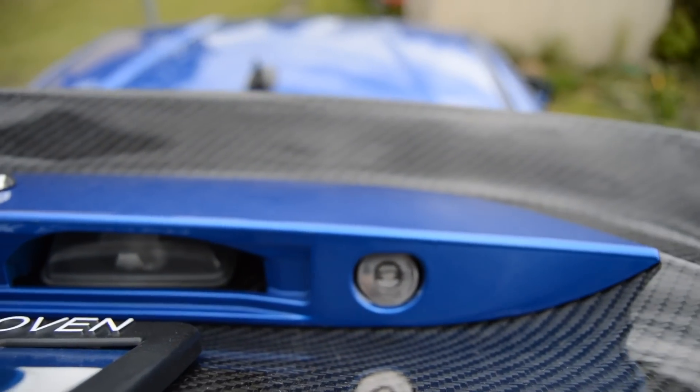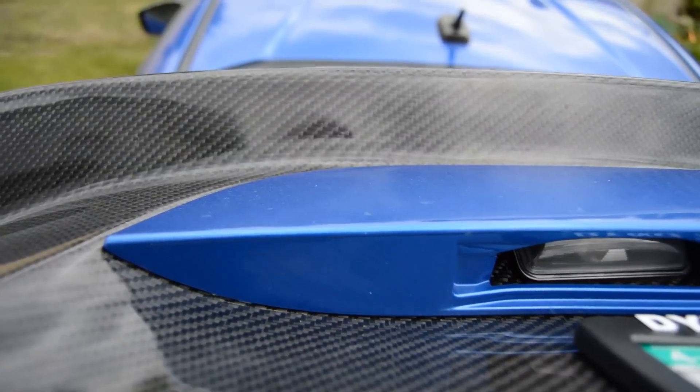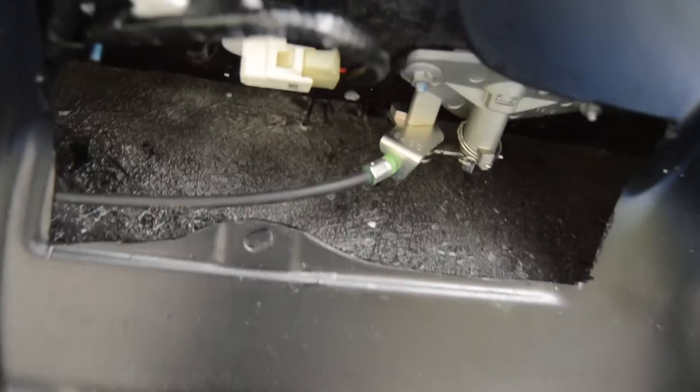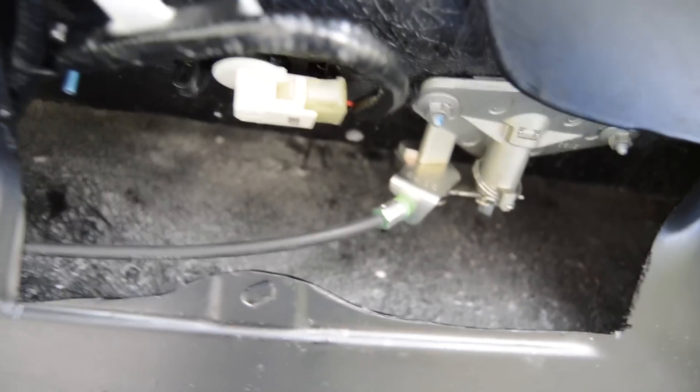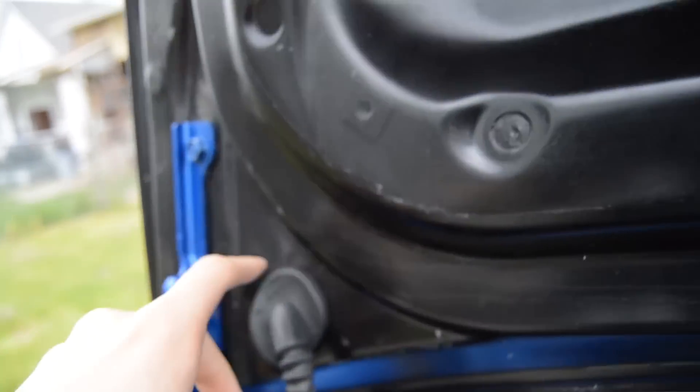Once you get everything off the car, the part that holds your lock in place — right here — has two 8-millimeter bolts, and it holds the faceplate as well. There's an 8-millimeter bolt there and another one right there. A lot of people don't know this car has a keyhole lock, and that goes to the stock part. I did reuse the stock blue piece because I liked the way it popped with the paint. There are about four or five 8-millimeter bolts up there to come off so you can swap everything to the other trunk, then feed the wires up through this hole all the way through.